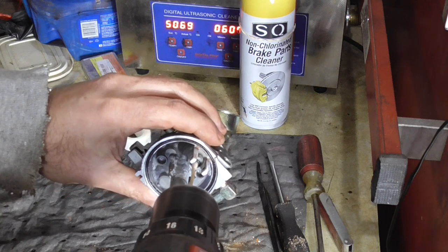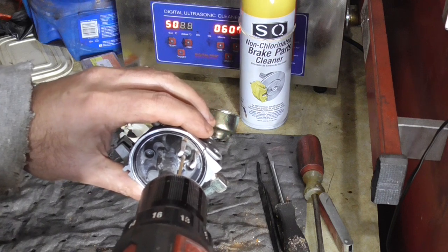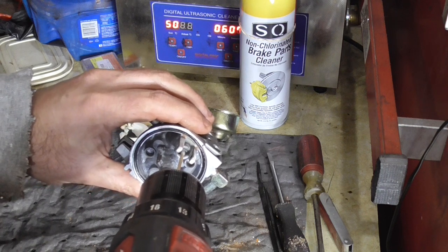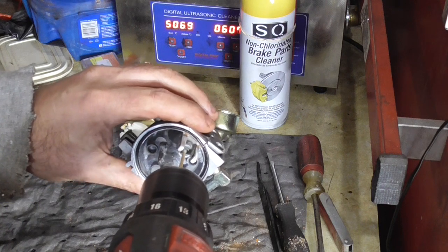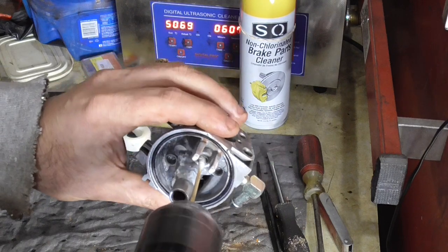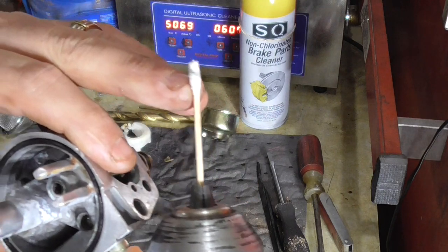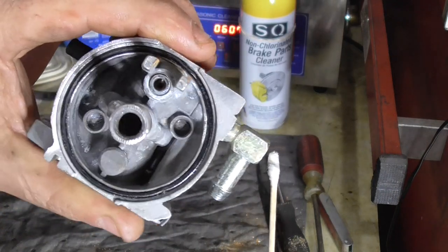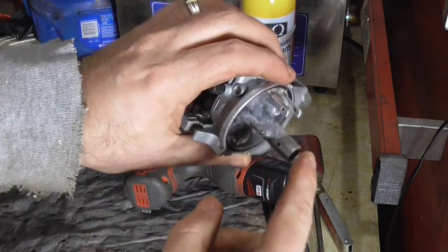We want to be real gentle. Now if you have one that's in really bad shape, you could use a little valve grinding compound and that'll kind of hone it in, just like it seats a valve. You can see the remains of some rust on this carburetor — it was really wet and dirty. This usually gets a lot dirtier; it doesn't look too bad. It even looks nice and shiny in there.